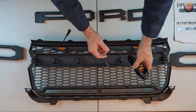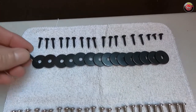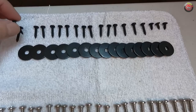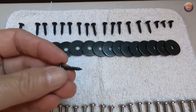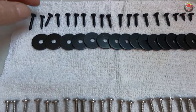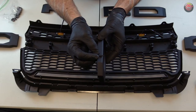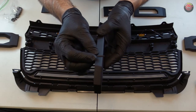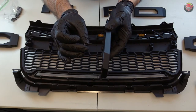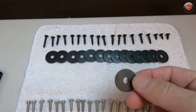Also included was a small and well-done wiring harness for the LED lights, which has to be put together. There are also a collection of screws and washers to secure the wings and the letters, which in my case was not only incomplete, but I decided to replace all of it with a better selection of sizes. First, there were not enough number 8 by 3/4-inch sheet metal screws provided for all the attachment points. Second, and most important, the length of the screws was too long — I watched another install video where the person experienced dimples and poke-throughs on the face of their letters because of this. Third, the fender washers provided were simply too large to fit in some of the tight spots where they're needed.